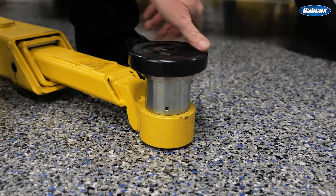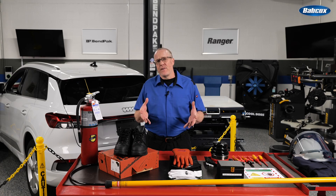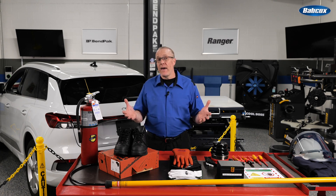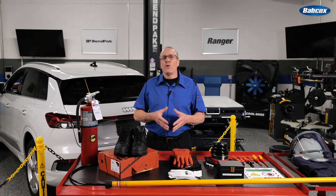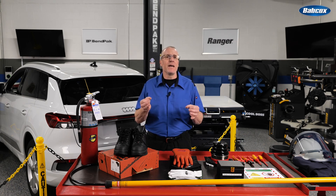When it's time to remove the battery, you'll need a battery lift table that's suited for the job. An EV battery can weigh from 1,000 pounds to well over 2,000 pounds. On top of that, all battery packs may not be equally balanced. So not only must a lifting table be able to support the battery's weight, but it must do so while offering the stability to handle a potentially unbalanced battery while allowing you to roll it out from underneath the vehicle.